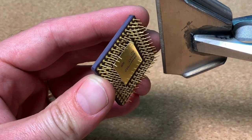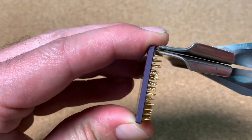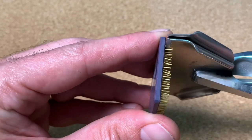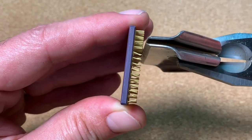Just put it in between the first row and straighten up all the pins at once. Easily you go from row to row. After finishing, you turn the CPU 90 degrees and repeat everything again. After some minutes, all pins are perfectly straight and the CPU will fit nicely into a socket.